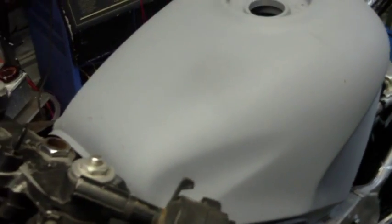I managed to get the fuel tank sandblasted just towards last autumn, so that's going to be painted up. I'm going to have to build a charger inside the fuel tank. I still haven't made up my mind what kind of approach I'm going to take to the charger — I'll probably just cobble something up for now to let the bike do a few test runs, and probably end up doing a little small version of the EMW charger to handle that.